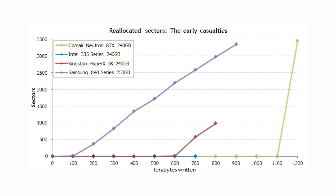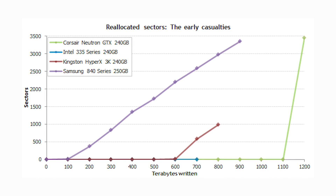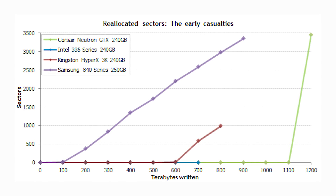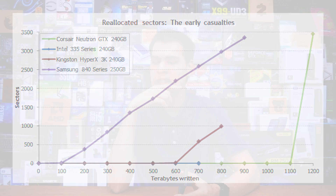The drive straight out of the server back from 2012. Back then I thought these drives were pretty good, and a lot of the reports at the time said these guys would have great durability and great lifetime. Fast forward from 2012 to 2018, we see that this has definitely had some really decent lifespan. If we take a look at the graph from the awesome people over at the Tech Report, who did an experiment seeing how long drives will last and actually had one of these 840 series in there, we see that whilst there are sectors being reallocated, at 700 terabytes the Samsung drive is still definitely not too bad and has some life in it. It usually caps out at around 900 terabytes written.